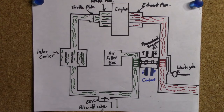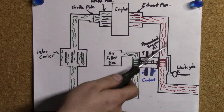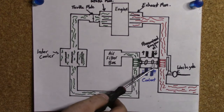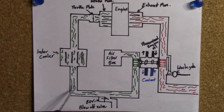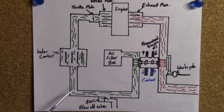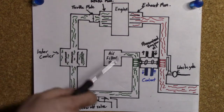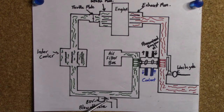The second component we need to talk about is your blow-off valve. When you're driving a turbocharged car and you let your foot off the gas pedal, your throttle plate is going to close, but exhaust gases don't stop coming out of your engine through your exhaust manifold and turning the turbine. As a result, the compressor wheel is still going to turn and create boost even though your throttle plate is closed. If you don't have a ventilation system for this, the boost is going to damage something — your intercooler, the connectors, or maybe a seal — and you're going to have a boost leak. The blow-off valve's job is to ventilate the system once you let your foot off the gas and the throttle plate closes. It's usually vacuum operated, opens at a predetermined boost pressure, and lets the extra boost exit so it doesn't damage the system.